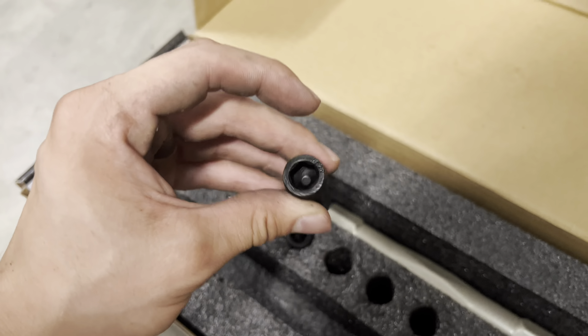If you're wondering, all of these bolts are size 17. It also helps to have an air impact. The new one looks smaller but I'm gonna make my adjustments and we should be able to throw it on easy. The top bolt is a three-eighths, and you can use the same nuts from the OEM one. To make adjustments, just tighten and loosen the arm, and there are two locking nuts to secure it.